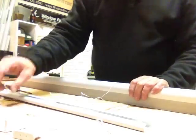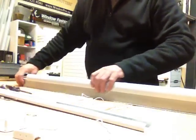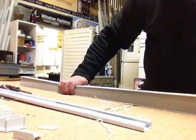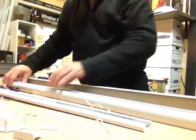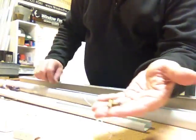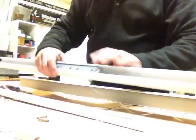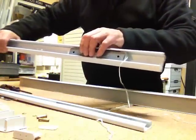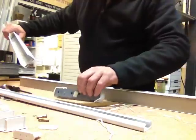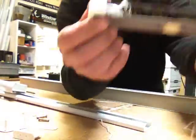right now I've taken the cord out and the cord guides, and that will allow you to slide the head rail completely off, leaving just some material. And then these two pins dropped out that were being held by these cotter pins. That locks the motor in place. But now we've just taken this apart, and we have the spring drive motor here.